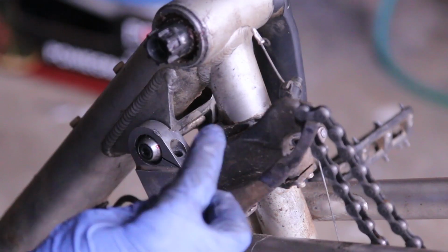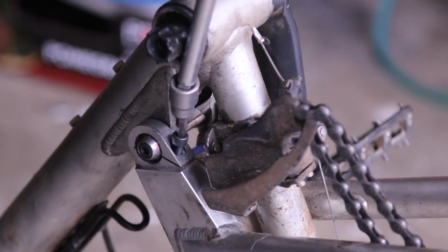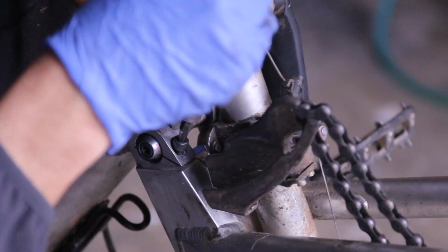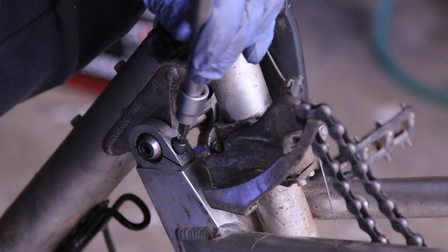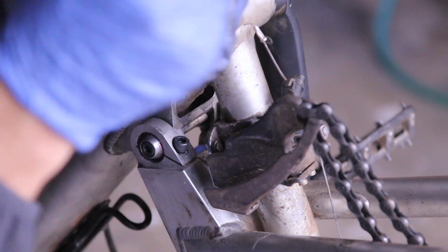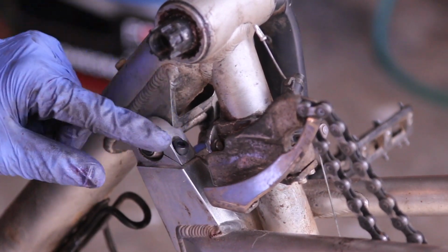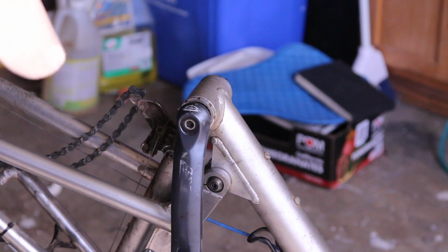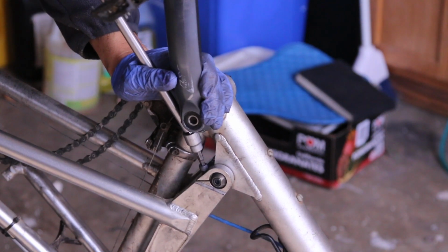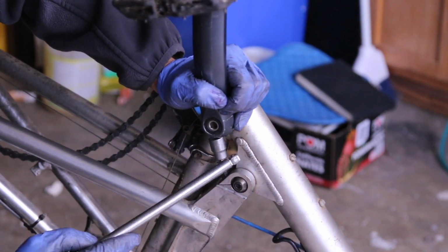Our steel pinch bolts as well, and they go here. So this, hopefully, I won't need to do anything else. And hopefully, this is going to work out. There's these swivel type of, see, like on this one, it's a swivel. So this part is round, so you could actually kind of twist it a little bit. Pull this out, hit it. You don't have to over tighten this, because you also don't want to crack the aluminum. The other bolt on the other side. Usually the bolts get stuck, so I just tap them like this.